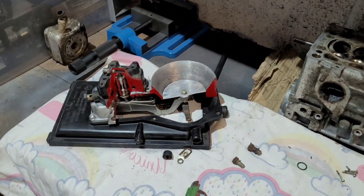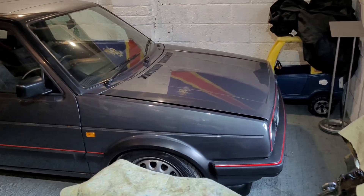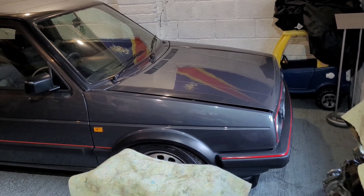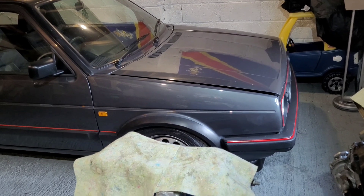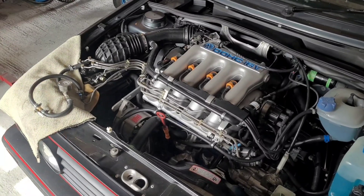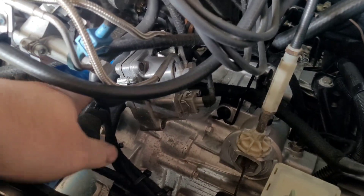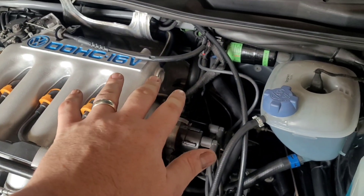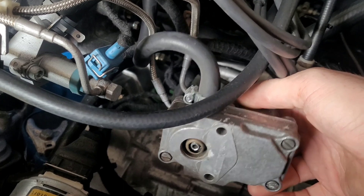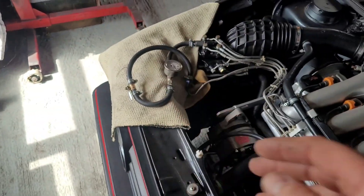By using our car as the live assistant, we'll run her up, get the gauges on. I've adjusted this one already, but I'll physically show you with the allen key in there what the pressure is at cold, see it warming up, and once it's warmed up I'll adjust mine back and forth so you can see how the adjustment acts on the gauge. We've got our gauges all set up ready. On the Golf, the warm-up regulator is sat down there; on the XR3i it's up in this area, and various other locations.